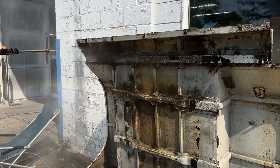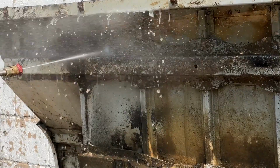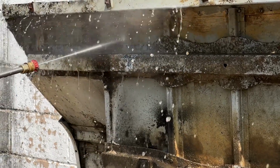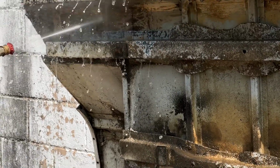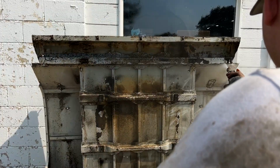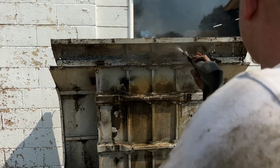In addition to the chassis, it's good to get up underneath the rear tub, because these cross braces here are made out of steel, whereas most of the rest of it is made out of aluminum. So you get a couple of things happening, is that the two dissimilar metals meeting will create a corrosion, but then also if that steel is touching the chassis, or if the protective padding has worn away, that can rust really quickly, and that's a painful repair to take on.